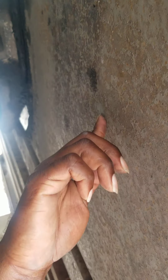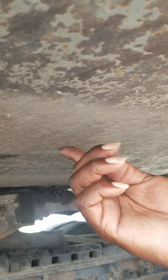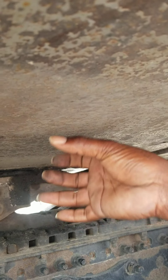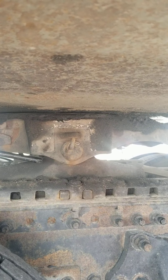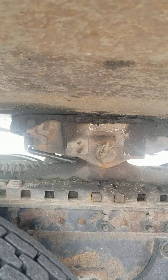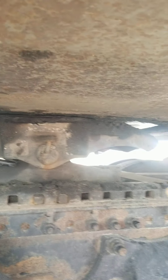This is the apron. The apron has not been broke or cracked, not missing nuts, bolts, or screws, no illegal welds, no holes or dents. Connected to the apron, you have the kingpin and the shank. The kingpin and the shank have not been broke or cracked, not missing nuts, bolts, or screws. It's properly mounted and secure.